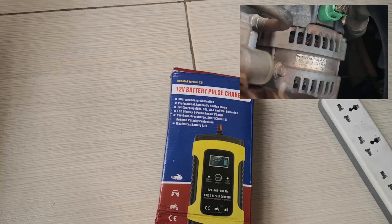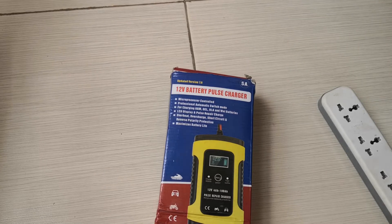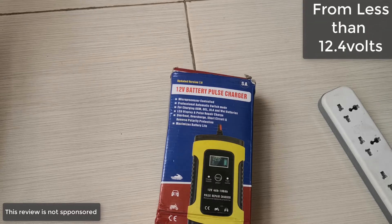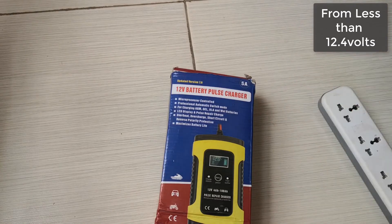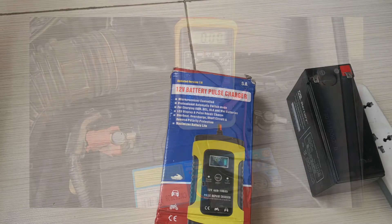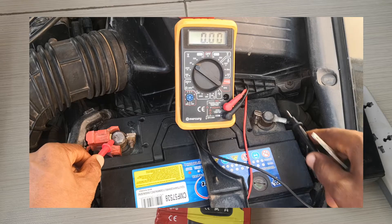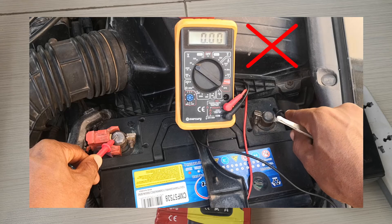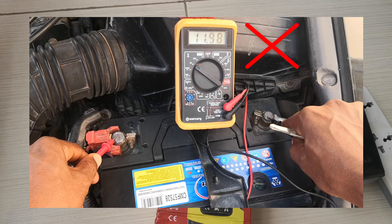Car systems or the car alternator is not meant to charge a battery that is flat, and where you're driving stop-and-go traffic, you don't necessarily have the opportunity to run your car over a prolonged period so that the battery is properly charged. At certain voltages, batteries begin to form lead sulfate crystals — that's what's called sulfation. Those lead sulfate crystals coat the surface of your battery. Over time, those areas coated with lead sulfate crystals will stop taking a charge, and only portions of the cells of your battery will be working. This sulfation is mainly supported by the fact that at less than 12.4 volts, electrolyte stratification occurs.